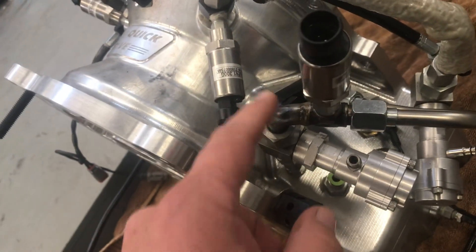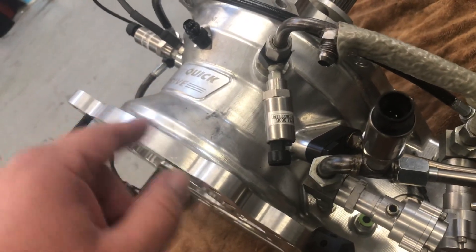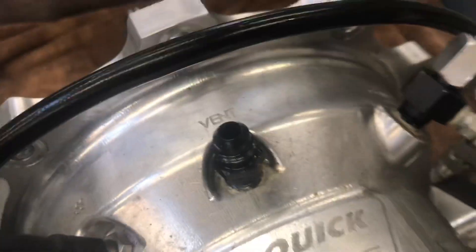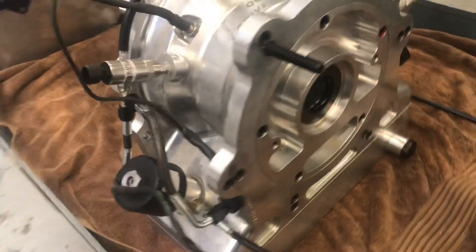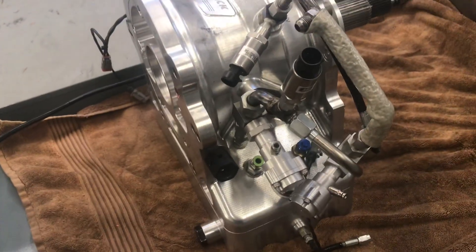This is cooler pressure coming out of the converter, in the circuit that leads back to the lubrication oil inside the quick drive unit. Because it's upstream of the jet it can see what the cooler pressure is doing. This is just a number six vent line that needs to go to your overflow tank in the back of the car. This is lockup pressure — labeled 'lockup' on the billet case. And ISS here — not International Space Station — is the input shaft speed sensor, which tells you what's going on with the input shaft, whether the converter's locked or not.